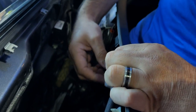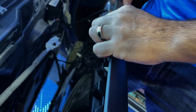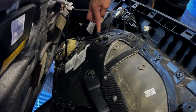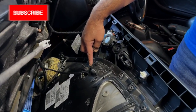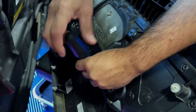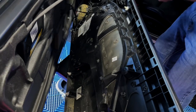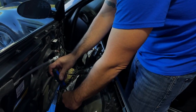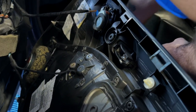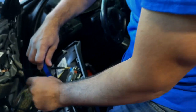There's another screw back here — there's a cap, and what I do is just take my little screwdriver and push down in the corner. Now there's also clips. Behind the door, this will come right off. To remove the handle, there are one, two, three, four, five screws — all Torx bits, same size. This side's going to be a little trickier because it has the mirror adjustment switch, so we'll have to cut it out.